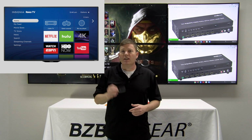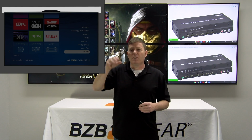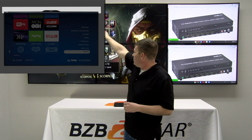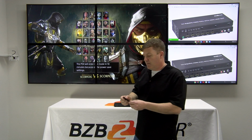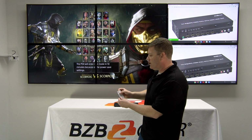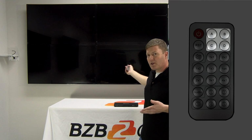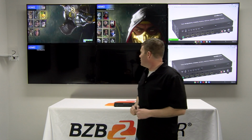Well, with this unit here, you can actually get that TV, and if you were to hang it upside down, meaning flip these 2 top TVs upside down, the bezel impediment would then be on the top. But then, of course, your picture would be upside down. Well, with a simple ABCD correction here, I can actually flip the image, A representing TV1, B2, C3, 4D, you get the point. Takes about, again, 5 seconds in between these little switches.